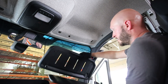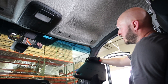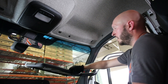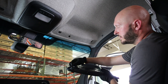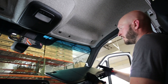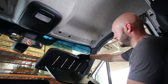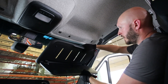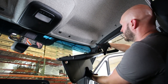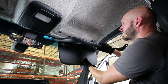The visor's in two pieces — you've got the handle and shelf, and the visor itself. What we're trying to accomplish here is: the hook on the end of the visor is going to go through the handle and grab some sheet metal right back here. On the shelf handle part itself, there's also a hook to the left that's going to do the exact same thing on this side — hook onto some sheet metal. You have to do this all together. You can give yourself a little more leverage by turning the hook straight up and down before you put it into the shelf, and just put that hook right back into where it came from. Then click the visor into the shelf, get that hook to grab the sheet metal, and get this side of the hook to grab the sheet metal there. Starting with the big hook will usually get you into a better position.